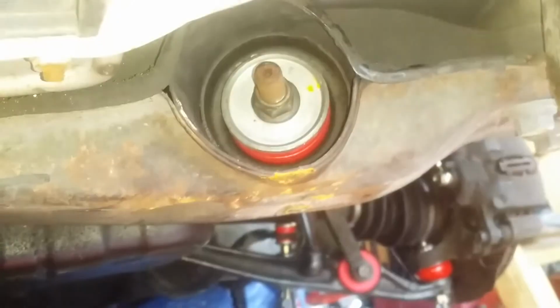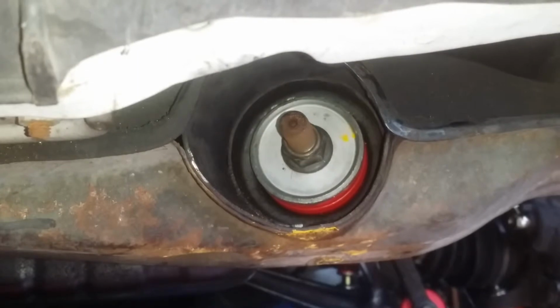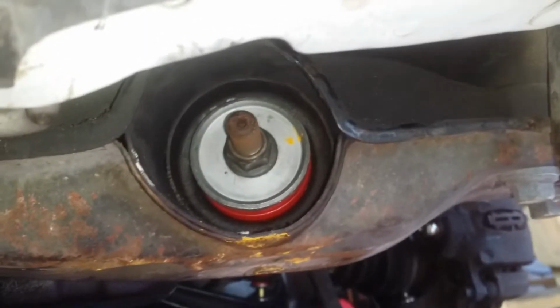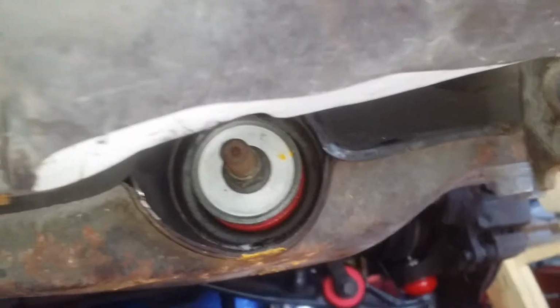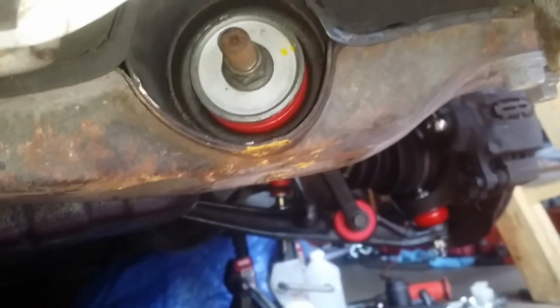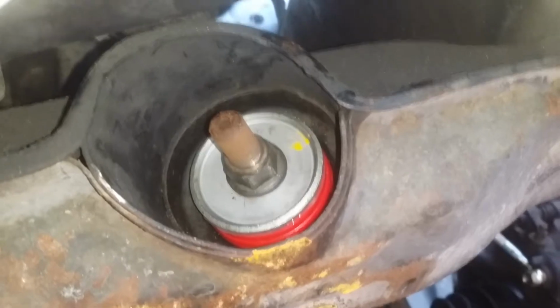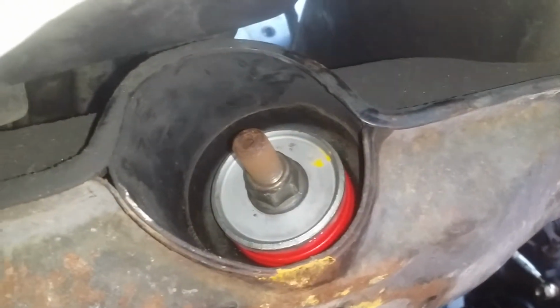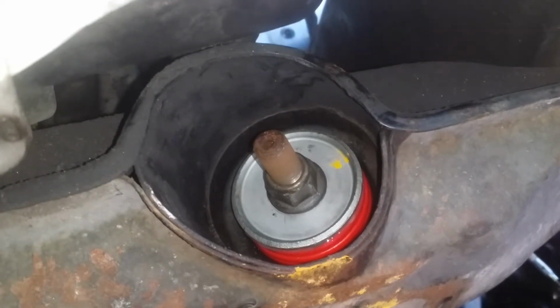That is probably it for today. I wasn't quite done after all. This is a front radius rod, is what the terminology is, and Honda has it listed as a front strut, part number 16.7102. And to get these loose, I think it was a 19 millimeter, actually I think it was a 17, and this is also supposed to be those nuts that get replaced.